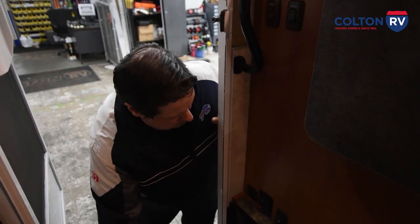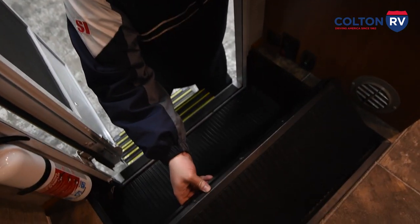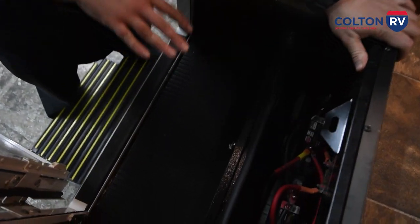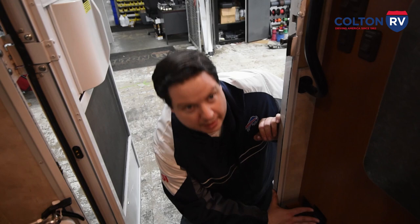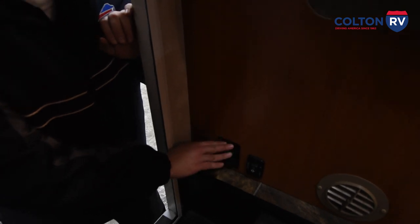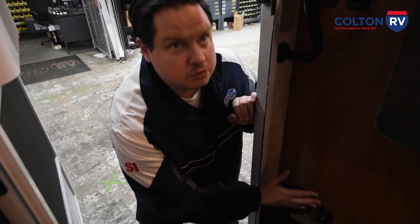Before I come in, there are a couple things right inside the doorway worth noting. First, the batteries: underneath here there's a latch on the front — you just unbuckle it, like a toolbox-type latch. This is the batteries that run the living quarters — the house batteries. Good idea in the wintertime: if you can remove these and put them on a maintainer, that will prolong the life of the batteries. When you're not camping, you don't have to unhook the cables every time. They have a battery on/off switch right here on the side. This disconnects everything inside the RV that runs off the 12-volt house batteries, so there are no parasitic draws draining your batteries when you're not using your RV. Typically when you're camping, you just turn it on and leave it on, and when you're done and it goes in storage, you hit the switch and turn it right off.